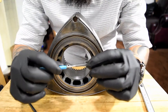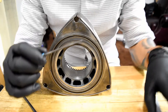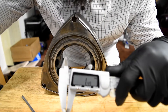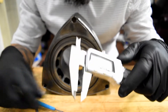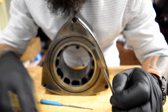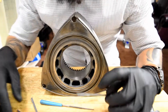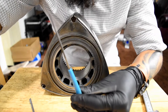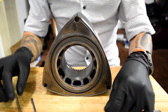We're gonna need a little filing. The top part is less than two millimeters — let's measure it. Opening the caliper — it's 1.50, 1.49. Okay, so this is gonna work. And then the other one, same way, is two millimeters on the skinniest part. We have a flat one, a conic one right here, and another conic one. So we have three filing tools: a flat one and two conic ones.